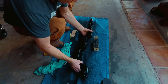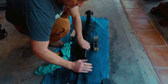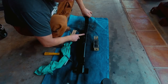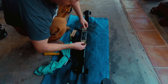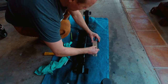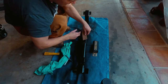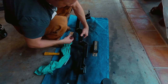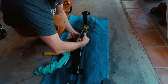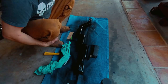Beginning of the cross member that's going to hold up the transmission. It's gonna sit this way with this being the driver's side. Here's the cutout I've made for the exhaust run through, and this is gonna be the actual support. This is gonna go right here. Hopefully you can see that I transposed these two onto here and have cut this. So when it's on, hopefully this will be able to be fixed right back down. But yeah, I'm excited with how this has come out.